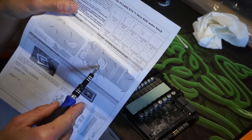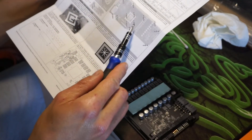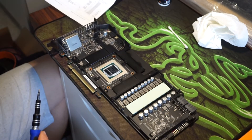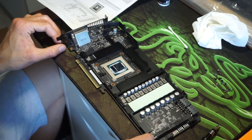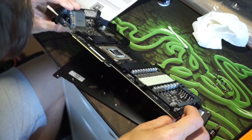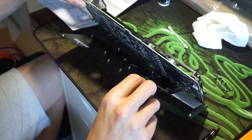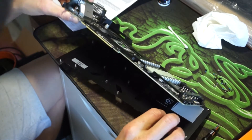I've just realized I've actually skipped a step — I need to remove the back plate of the graphics card first. Going ahead and removing all those screws: one, two, three, four, five, six, seven, eight, nine, ten, eleven — thirteen screws total. Also one on the back I missed. There's also a little ribbon connector under the bottom here, so make sure you don't just yank that off.